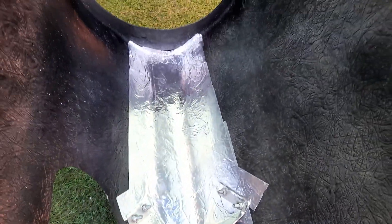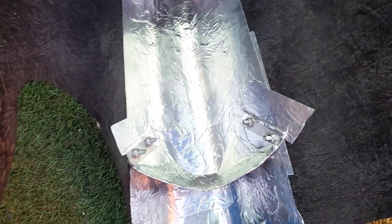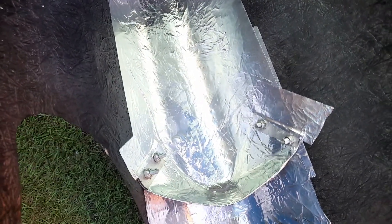So I've built in a catch wall inside the lower fairing. If you imagine the engine goes pop — everything spews out the bottom into the belly pan — the oil will collect in here rather than spew out onto the track. You will not get onto track or through scrutineering unless, with a four-stroke, you have this modification done.